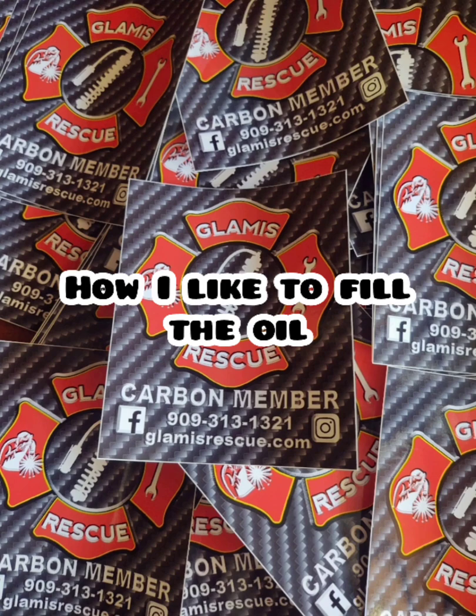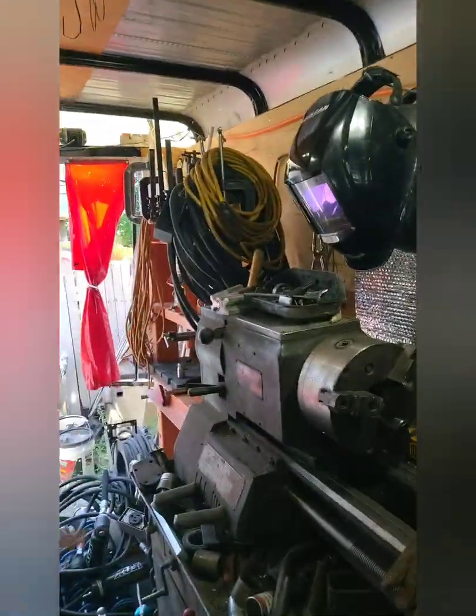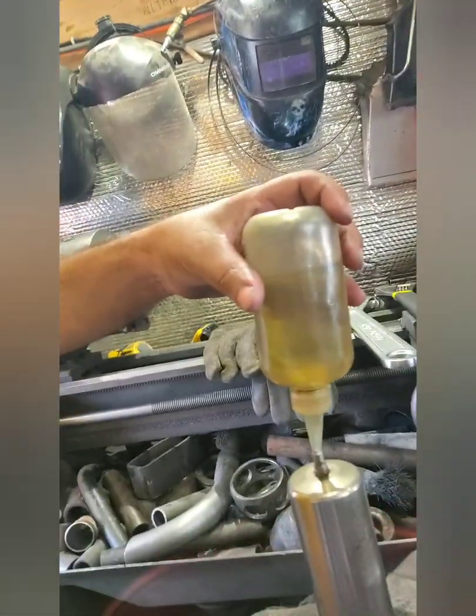I'm going to insert the shaft, assemble it, and show you how I physically fill it through the Schrader valve. To torque the main cap on I chucked it up in the lathe again to apply enough torque, and now it's back on the vise. I have roughly six ounces of oil here. The Schrader stem isn't inserted yet, so I just use my little squirt bottle and let it gravity feed. This takes maybe about 10 minutes. In winter I preheat the oil with a hair dryer to get it flowing quicker.